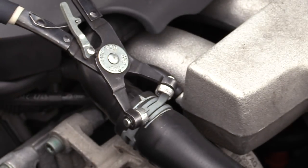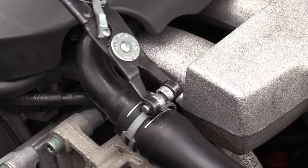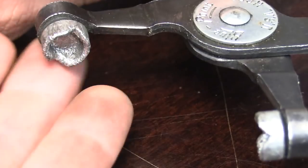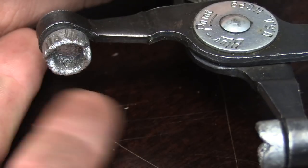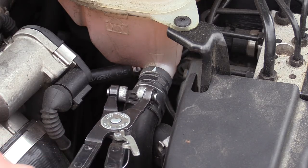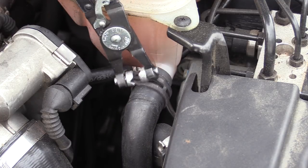There are tons of these spring clamps on modern cars, and after going through several pairs, these are the ones I fell in love with. The key to these being so good is that they have two cups to grab the hose clamps. Other styles have a flat piece on one side and a cup, and that works okay, but you have to grab the clamp in the exact right spot or they don't hold. With these it doesn't really matter where you grab — you're able to get a grip, pull the clamp open, and then rotate it to a better spot if needed.